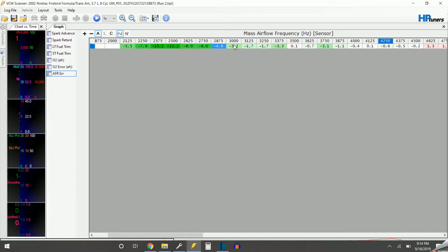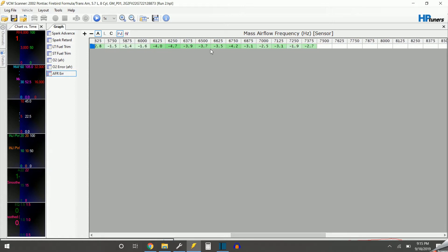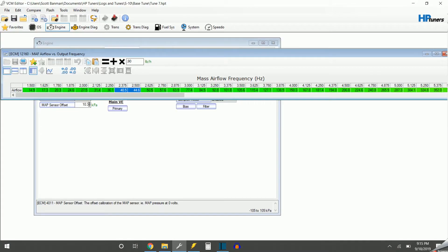For an 8% error I might do a 4% hit between both cells and now you're down around 2–3% range again. If it's under a percent difference I'm not really all that worried about it — I'll keep it where it's over a percent difference. You're never going to get dead-nuts on; it's just not going to happen. If it's ever lean, I always try to change it to being slightly rich — I'd rather have it slightly rich than slightly lean. It's going to save your engine in the long run. Then make those changes in the PCM, reflash it back, go out and make runs again and again until it's dialed in.